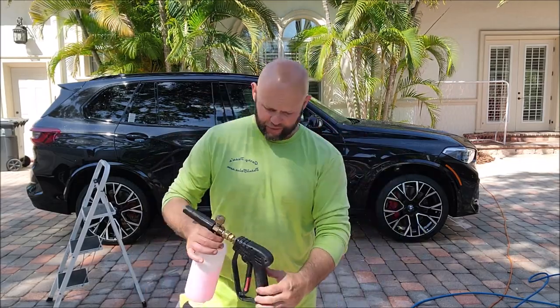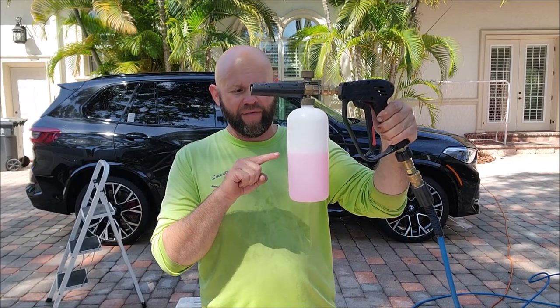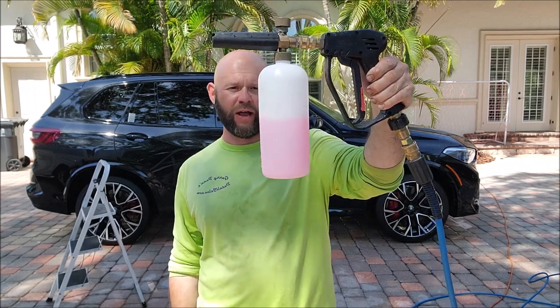You can use either water as your lube, or what I recommend is to use the original Infinite Use Detail Juice, mixed up and diluted. Spray it on the surface, use the clay bar, then you're gonna wipe everything down that you've put there to make sure there's no clay bar residue on anything. Then you're gonna mix up your foam cannon like I have here. I have 1 ounce of the wash and coat shampoo, and then I filled it halfway up with water.